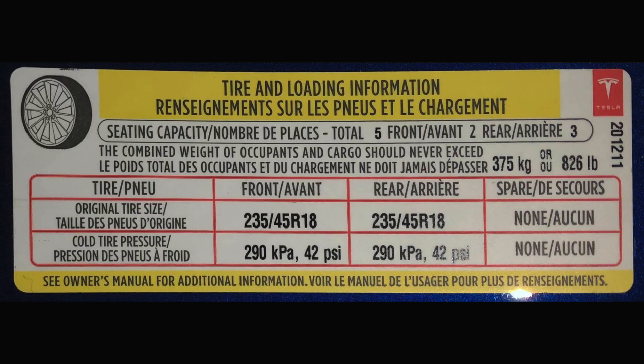The last tire check is tire pressure. Tire pressure is very key because it needs to be properly inflated to support the heavy vehicles — the 4,000-plus pound Tesla and the 550-pound motorcycle. Usually in the car, when you open the driver's side door in the door sill, there's a mark for what your tire pressure should be for the fronts and rears. On the motorcycle, that marking is not on the bike itself — it will be in the user guide, or you can look up the manufacturer-recommended tire pressure online.